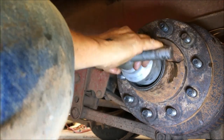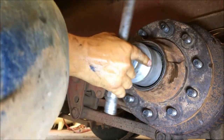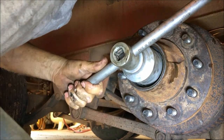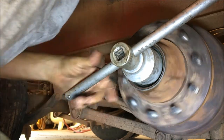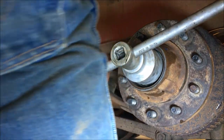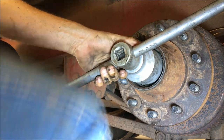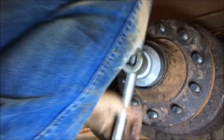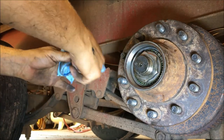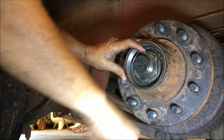Tightening in the seat of the seal. I've always been taught that it's a good idea to tighten it and then roll it to make sure all your bearings are seated — make sure you didn't have something stuck a little bit. After that, back it off. I like to back it off and then just finger tighten it. This one's calling for, like most wheels, one to ten thousandths of free play. I'm going to try going one-sixth of a turn back.